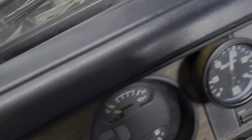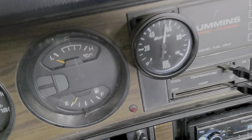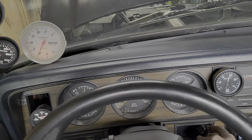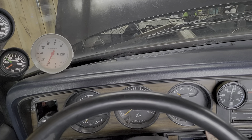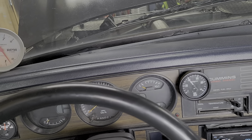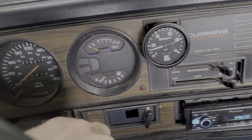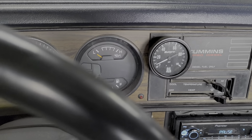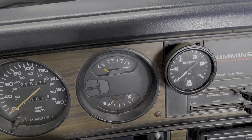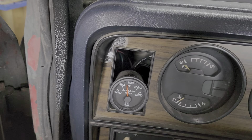So what I'm going to do — I have a manual shutoff on this truck. I'm going to pull that, and you'll see that when the engine shuts off, the oil pressure will still stay up. See that? You still have lots of oil pressure as the cam slows down and stops rotating. Instead of coming down to idle where it's only 20 PSI, this way it's shutting off at 60 PSI oil pressure. I think this is the ideal way to do this — everything is still up to temperature.